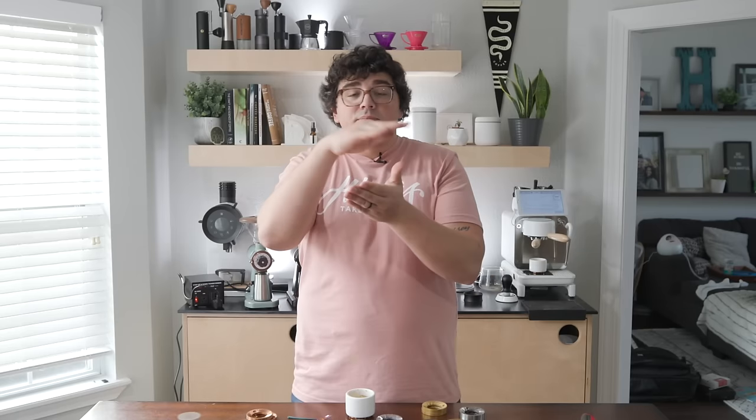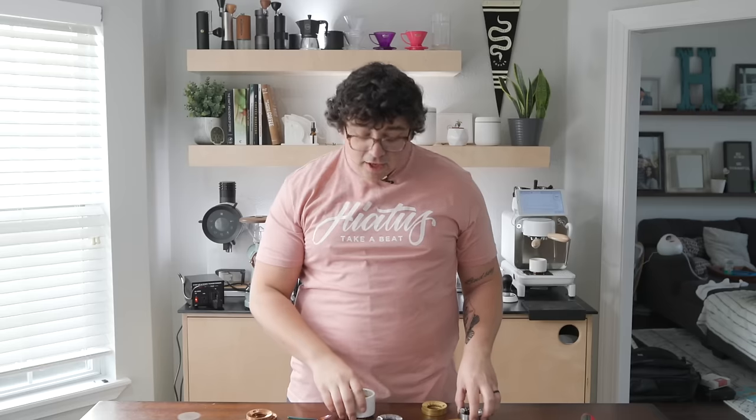You're going to take slips of aluminum foil and shim underneath your burr in order to make a complete wipe when you do the marker test, which you can just look up online. Maybe I'll do a video later. But for now, just know if you do take the time to align your burrs, you're gonna have a much better situation on your hands.